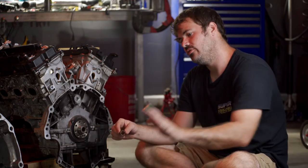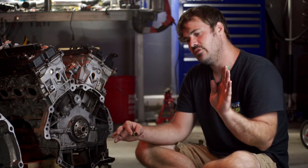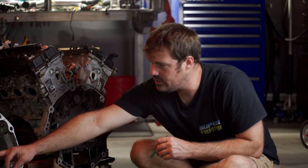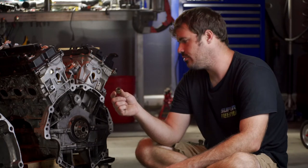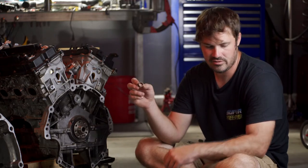A really big indicator for this is when you're engaging or disengaging the clutch, you'll hear kind of a grinding, hollering-type noise coming from the bell housing only when you're actually engaging and disengaging the clutch. That's the sound of the different shaft speeds between the input shaft and the crankshaft with this bushing dragging. This is very cheap from Nissan — only about five bucks. It's really too cheap, once you're in here, to not go ahead and replace it with a factory one.